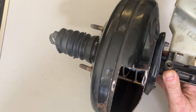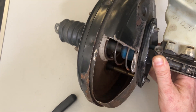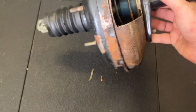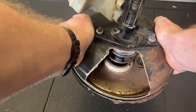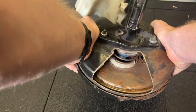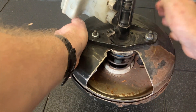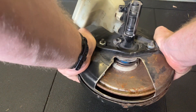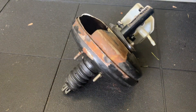So I hope that makes sense. What I'm just going to try and do now — and I haven't tried this yet — is try and push this down just to show you the action of the diaphragm moving. Come with me, I'm going to try and put this on the floor — hopefully I can get it to work because it's quite firm without it. Hopefully you can see that diaphragm moving there as you press the brake pedal, and you might be able to see those pistons moving here as if the fluid was going to the four corners of the car. And that's how it works. Hope that makes sense, and I'll see you in the next one.